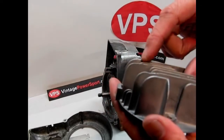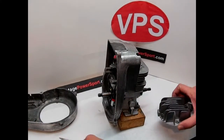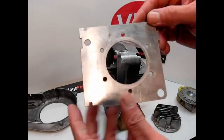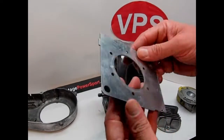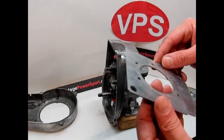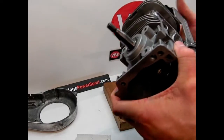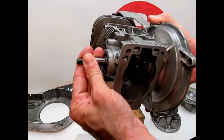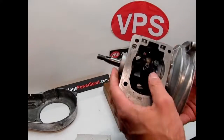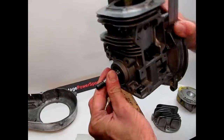I did have to remove a little material from a couple of fins to get it to fit under the piece we added to fill in the side cover. The special part I needed was this gasket — a remanufactured reproduction that looks just like the original. It's a sixteenth of an inch thick, point zero six four — a very thick gasket. This was sold with the MC5 as a hop-up when McCulloch introduced the MC6 stroker crankshaft for the MC5. This is a used MC6 crank I picked up at the big one last year in the same box of parts as the saw block, along with the connecting rod — some really nice finds for $35.